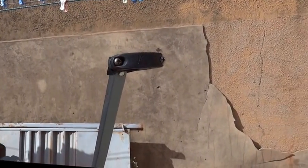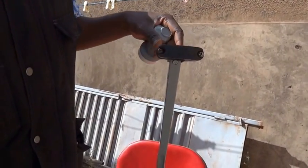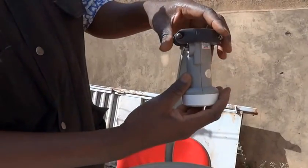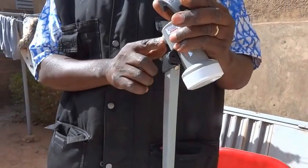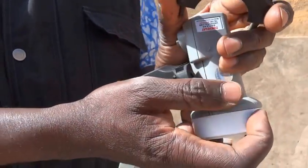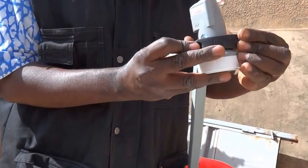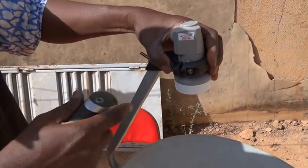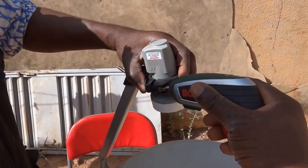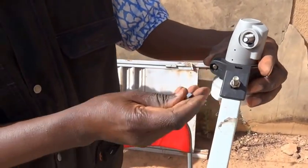That can be done with a screwdriver, but I will use this small device here, tighten here. Oops, now it's too tightened, slightly like this, put it here and orient the LNB so that the exit for the wire will be oriented toward the soil. Then I will put this screw in place. Yeah, then I put in place the screw here, and tighten it a little bit, the other one also, and I put it inside.